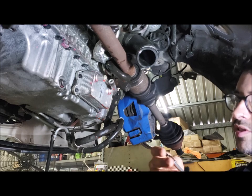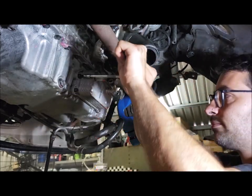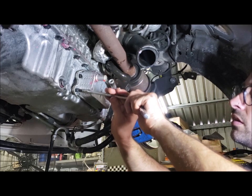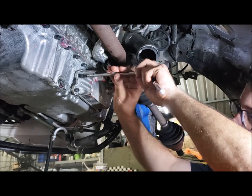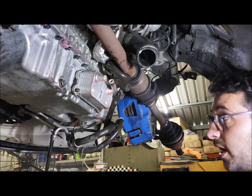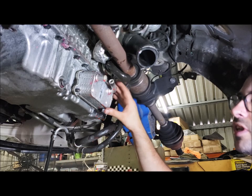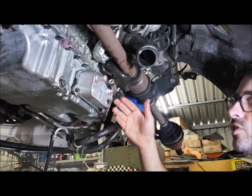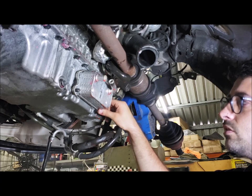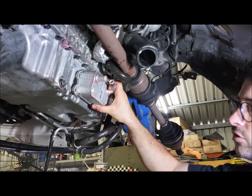Now we want to remove these four bolts. They're all the same — they're all a T40 Torx bit. Crack them off one at a time, they're not particularly tight. I like to wind the bottom ones out partway, then fully unwind the top two. Now, like I said at the beginning, we're not draining the engine oil — there's actually no need. The oil cooler oil flow is pumped through it, so it's travelling through a pumped path rather than just sitting there. Once you've removed the top ones, fully remove the bottom ones, making sure you've got your container underneath to catch it, and pull the oil cooler off.